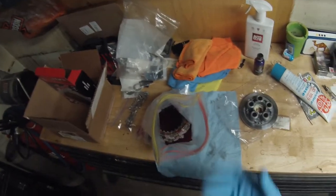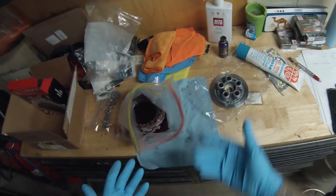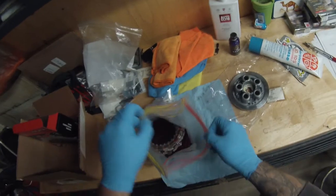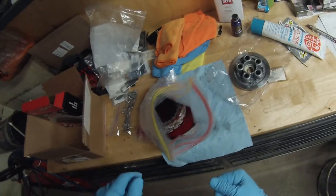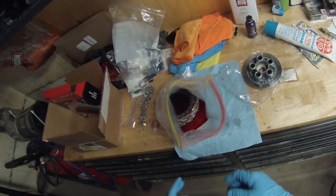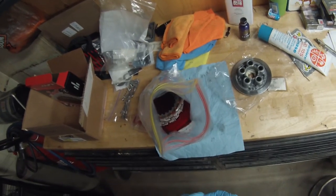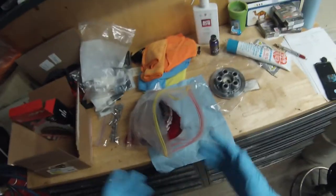For the frictions and steels, there's a little bit of conflicting information — you can run Barnett clutches dry, however the work instructions say to put a smear of clean engine oil on them. I just kind of did it by factory spec — it's not going to hurt anything. What I did was take three Ziploc freezer bags stacked inside each other, poured a bunch of oil all over them, and kind of let them sit for a while so they should be pretty well soaked. You can use an ice cream pail, but this way you don't have a container of oil to dispose of — you can just pour it right into your used oil container.